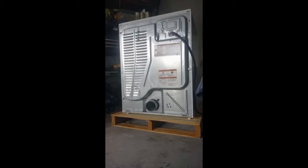We got a dryer that's making a squeaking sound. Motor's good, belt's good, so we're going to go in and change an idler. I did a pre-diagnostic on it yesterday, and so we're going to put a pulley idler in.